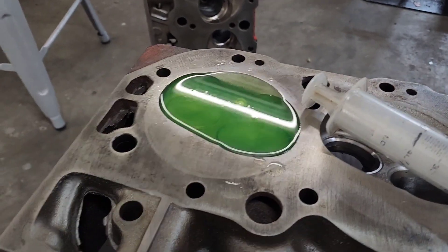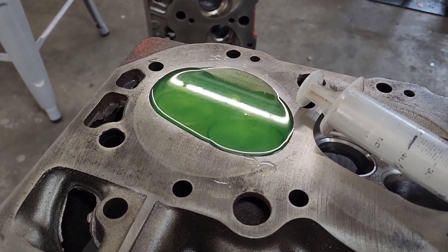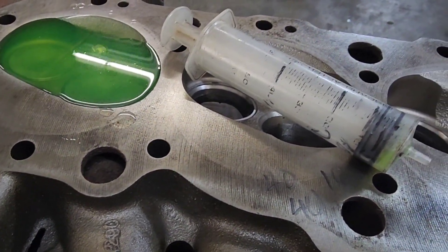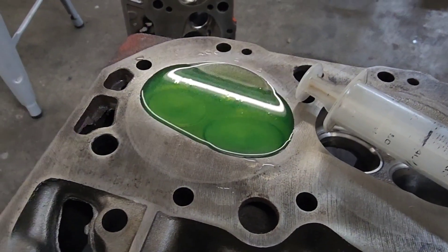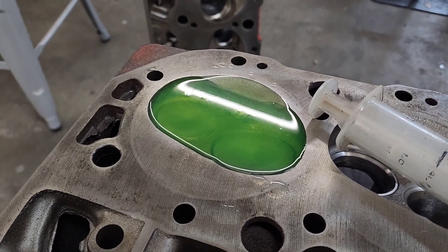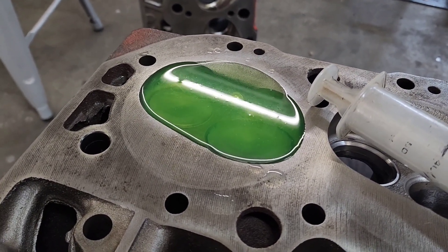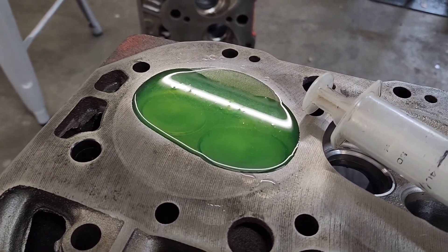My video shut off on me, but I finished filling up the cylinder head in three different shots with my measuring tool — 240 CCs and 116. My combustion chambers are at 96 CCs, give or take one or two. That'll get me within a tenth of a point on my estimate of compression, but that's the procedure I follow to measure my combustion chambers. Thanks for watching.